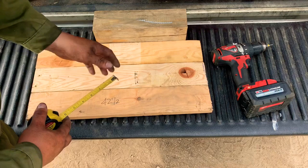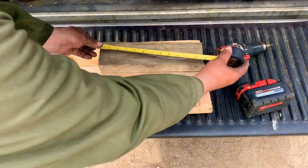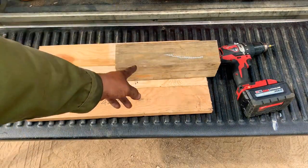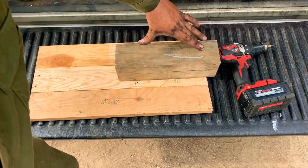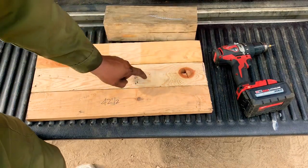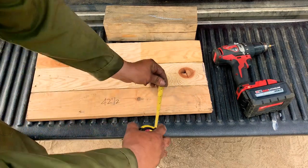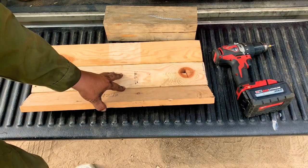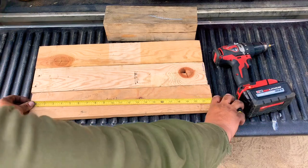For this we're going to be using a four-by-four piece of wood about twelve and a quarter inches long — just enough so the tire's width can touch it. We're also going to be using three pieces of wood, four-by-three-quarter (actually three and a half inches wide), and the length of them will be twenty-one and three-quarter inches.